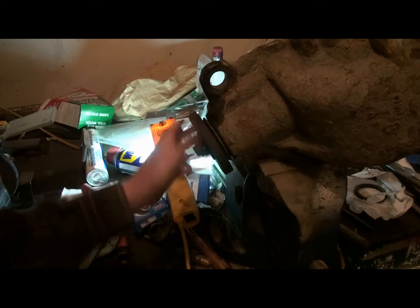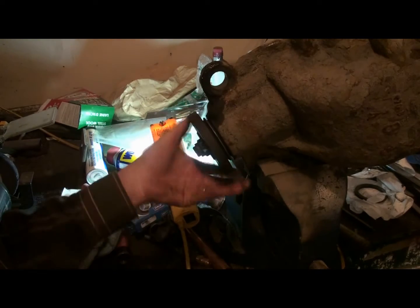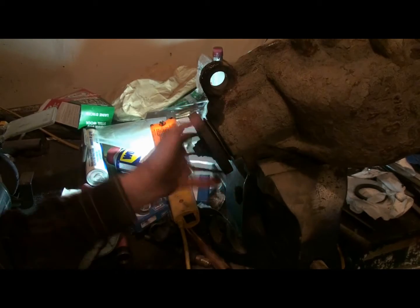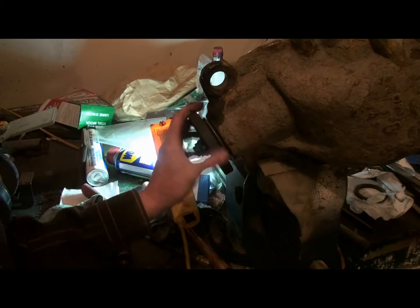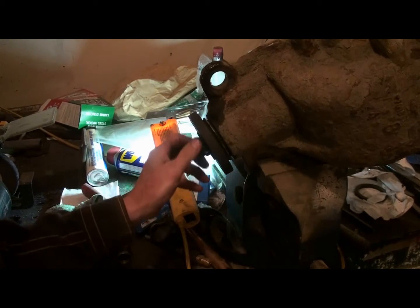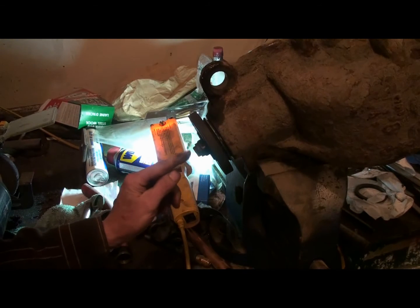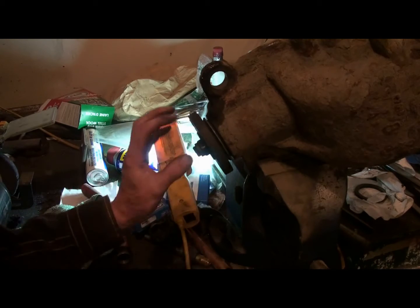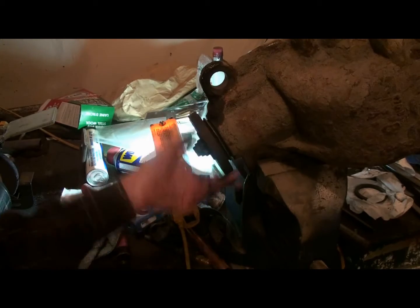So there's no slack in it. When you spin it, it doesn't spin anymore. It's actually a fair amount of tension on there. It stops as soon as there's preload on the bearings. The bearings have oil on them, so that's pretty good. We're going to take this apart now. I'm going to mark this very carefully so we have a reference point. We'll take it apart, put the seal in, and put it together for the final time.